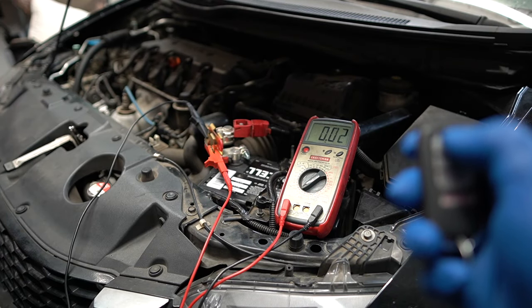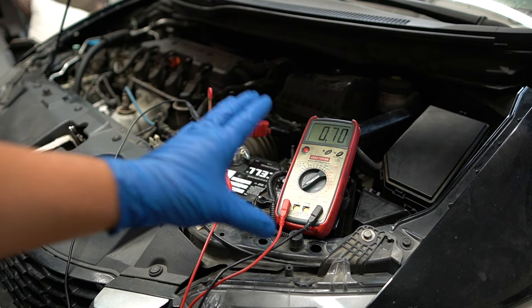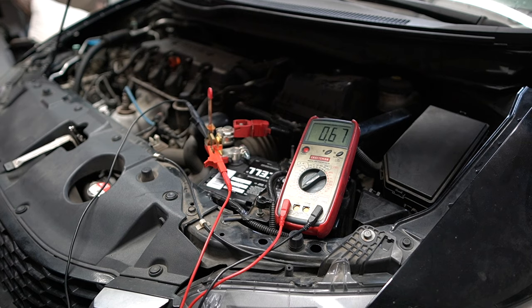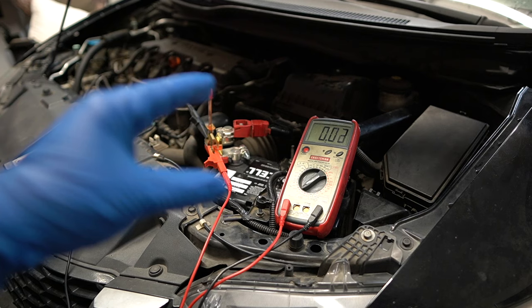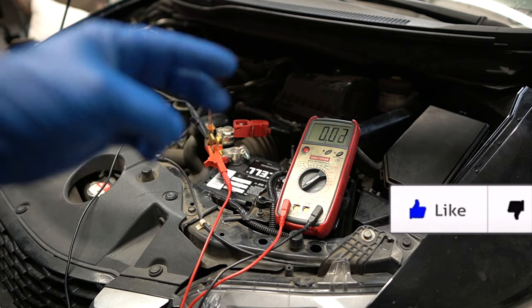I locked the car, opened the switchblade to let all amperage flow through the meter, and watched it. Initially around 670-680 milliamps as some modules were still awake, but after giving it time to sleep it settled down. There it is - 20-30 milliamps. That's right around acceptable draw. So that's the 2014 Honda Civic with a parasitic drain on fuse number 29, a 10-amp backup fuse. I'll put links in the description to everything I used today - subscribe and I'll see you on the next one.